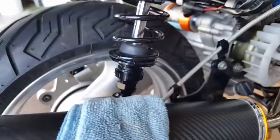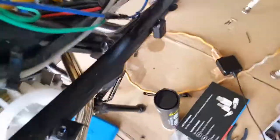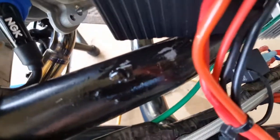Again, we're going to probably start cleaning up now. Yeah, let's go ahead and get that all ready, cleaned out. We're probably going to give it a little scrub down with some sandpaper, but let's just wipe it now. Just get that little spill out, because I think with sandpaper, even though we sand it down, all the debris gets stuck to the gel, and that's probably harder to work with. You can see how much lighter that took out. Even some of the areas that we had rust, you can see how it turns into a more silver color. So that formula does work pretty nicely.